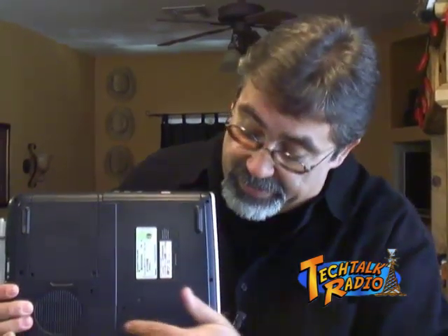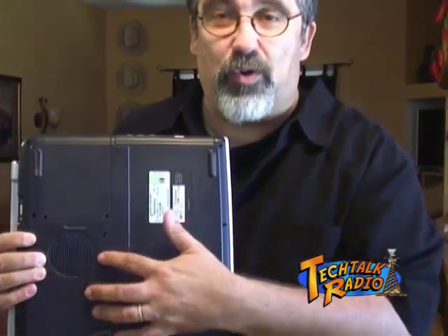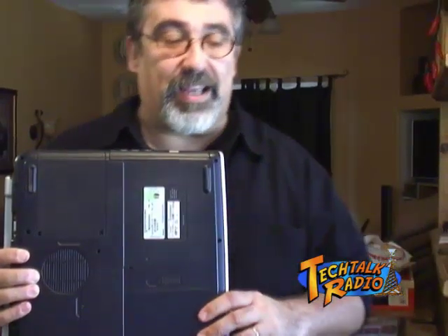In many laptops, they actually have it in two different areas. They'll have it under the keyboard and on the bottom of the laptop like we showed you on TV in this area right here. It makes it very easy to change. Now, we also find other laptops where they incorporate this all into one area, so upgrading is rather easy. I want to show you the steps on how to change the laptop memory in an HP 6201 series laptop.